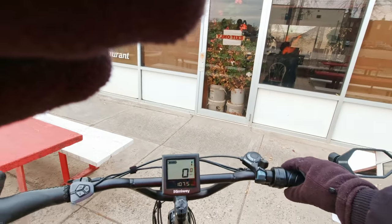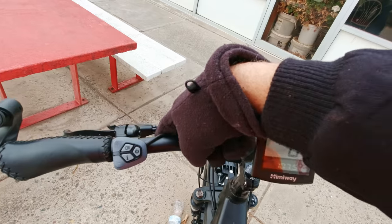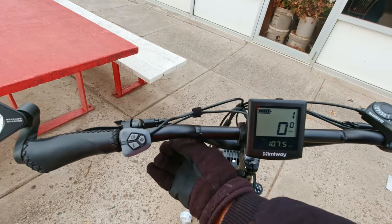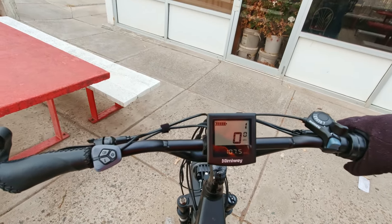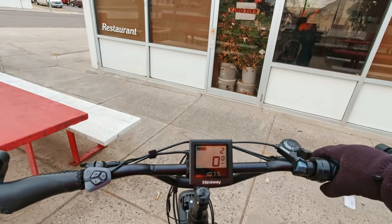Well, I think I'll get back on the bike and ride. Just a little riding tip in case you decide to get an e-bike: this one has what they call a brake cutoff. You'll see two wires going into the brake — one is the cable for the brake, and the other is a sensor wire. Both brake handles have that, and it senses when you put on the brake on either side and automatically cuts the motor out, so it can't overpower your braking.